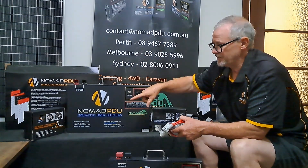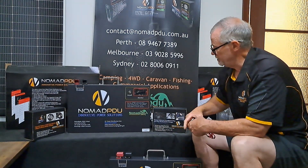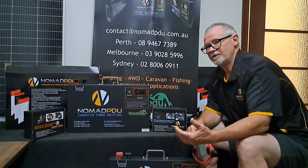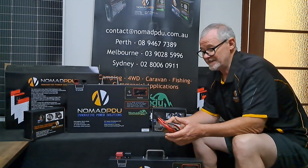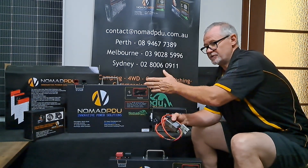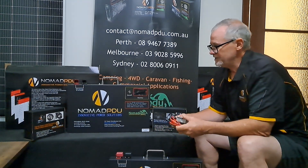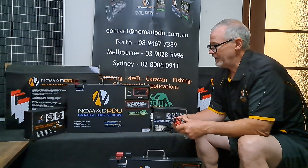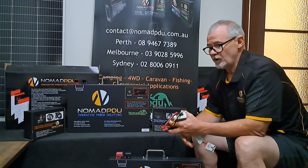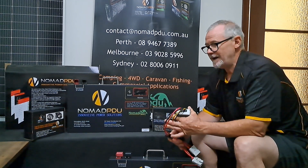Document your setup: this is the DC, this is what's connected, this is the cabling, this is how it's fused, and this is where the auxiliary battery is. That way, in future, when someone else looks at it — like us — we're not spending labor costs trying to figure out what the previous person did. It's a really straightforward setup: crank battery, VSR or relay, goes to your DC-DC, then to your secondary or auxiliary battery. I hope this didn't sound too condescending — a lot of people really don't understand dual batteries or what DC-DC even stands for.